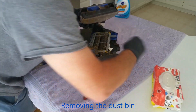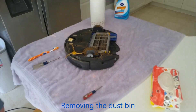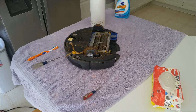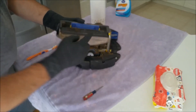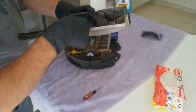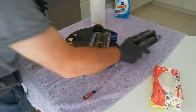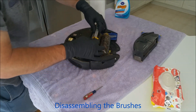You're going to have bulk material in the bin. I'm going to get that right to the trash can. I've got some contents inside — this part is removable and replaceable; I will probably wash that. You cannot dunk the entire bin because there's an electric fan motor in here — you will ruin it. So we're going to have to be careful cleaning this piece. This is the brush cover. It comes off. This is a model 660 Roomba.